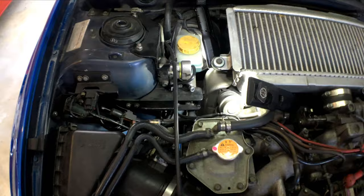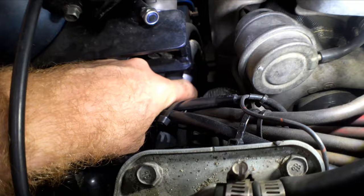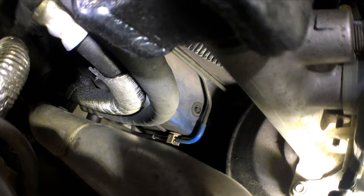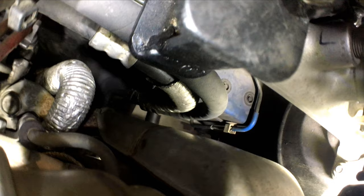Let's have a look at the problem — you can see it down in there. Here's the power steering hoses. The bottom one is the low pressure, the top one is the high pressure. You can see all the wetness down the bottom there. You can also see a hose clamp I put around the crimp fitting to temporarily tighten it up — worked for a little while. To get the set of hoses out you really have to raise the engine, and I really don't want to do that just to fix this hose, so I'm going to try and do it in there.